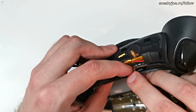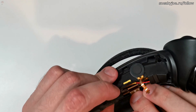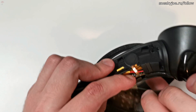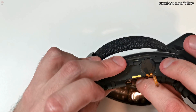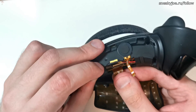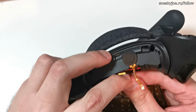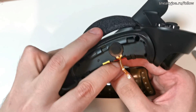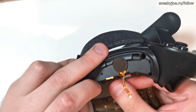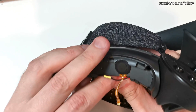Before inserting the battery into the controller, make sure to open it wider — you don't want to damage the battery housing. And after you've done with it, the last hard part is remaining. I've been struggling with this connector for about 10 minutes. You need to position the ribbon cable extremely precisely. After you do this, you will need to shut down the top cover. If the cable is mispositioned, it will not hold. You will need a lot of patience for this task. I'm not sure why Valve didn't use the same locking mechanism as with the smaller cable. When I was repairing my first controller, I somehow managed to miss the opening parts and shoved it back in wrongly aligned, and it held just fine. But after about 10 minutes of screwing around — great success. It holds in place. If it doesn't fall out, it means that you did everything right.